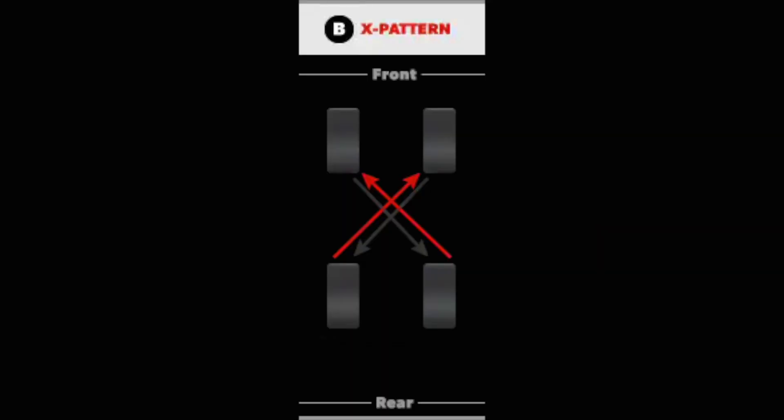One other thing with tires is to make sure you're rotating them properly on the car. I just had my Tesla in for warranty work — they came to where my car was parked for replacing some clips — but they also checked the tread, and the technician recommended a tire rotation. The tires on the Model 3 are directional, so you can't flip the tire from one side to the other. So instead of a cross pattern, you just go front to back. That's how tire rotation works with Teslas.